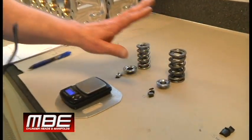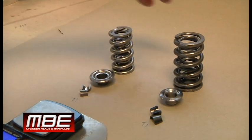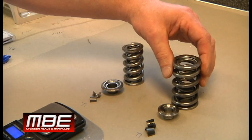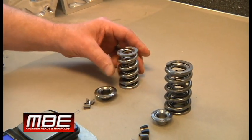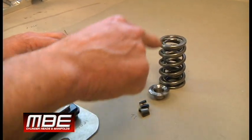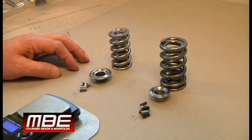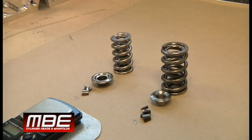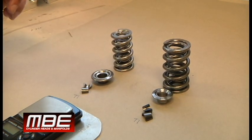So this is the old, this is the new. This would be a typical spring in a Bush car that people still run today in the dirt series. This is the new technology. The difference is the size of the spring — note that this spring will outlast this spring four to five to one, at $450 more per set. So you do the math; that's pretty obvious.